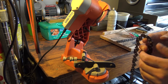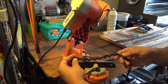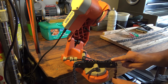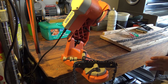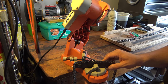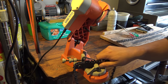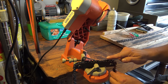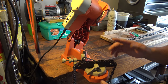Simply put, insert the chain onto the slider. Now you want the cutting edge facing you, or facing away from the unit. Actually, I shouldn't say facing you — you want the cutting edge facing the right. So if I go like this, it would take chunks out of my finger; go the other way, it does not.